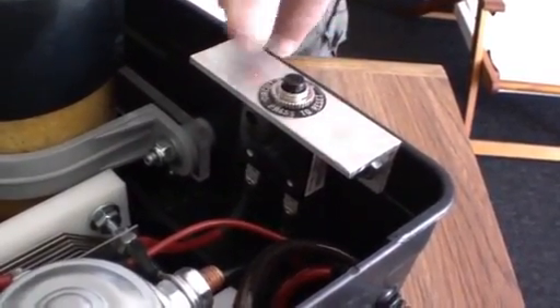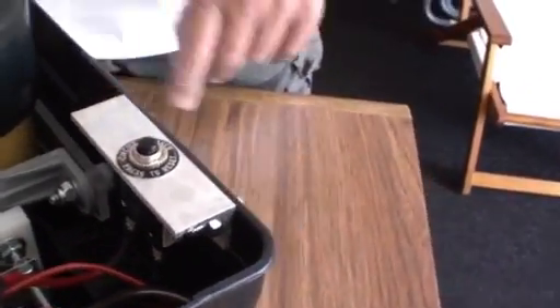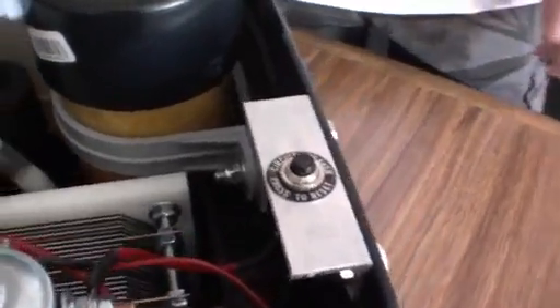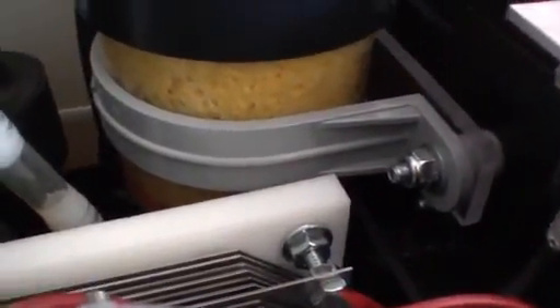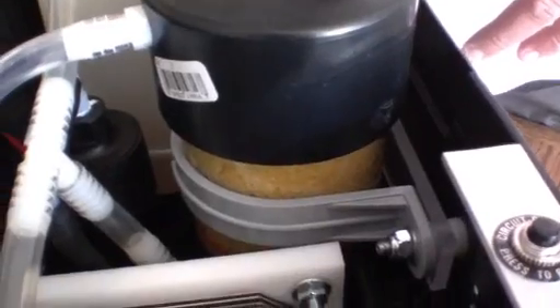This just pops off and then you have to reset it manually — so it's like a safety feature. And we have the bubbler, which has a filter inside. It has water to make sure nothing is going to go through your engine, just the HHO gas. It's like a filter.